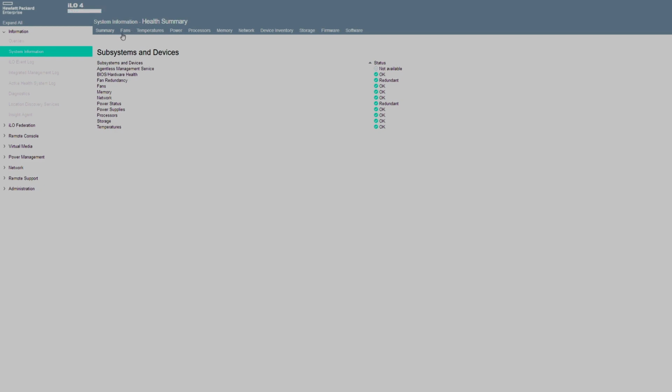I'll get into that in a sec anyway, but as you can see here, I did a fan mod on this as well to try and keep the fans so they don't max out. The max they can go to, I think, is 53%, and that is where the noise level gets a little bit annoying. So hopefully, no matter what happens with this system, as long as it has a half decent air intake from a fairly cold temperature, it should be able to keep the system at a good temperature.